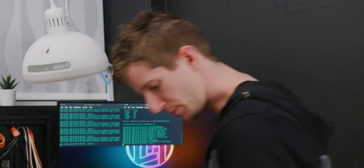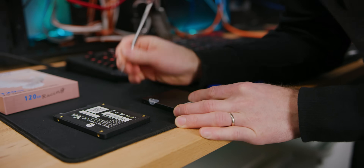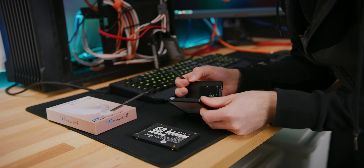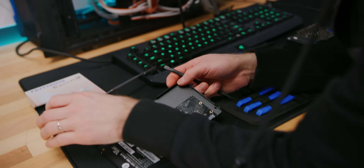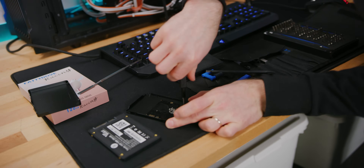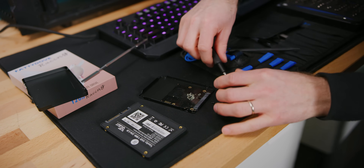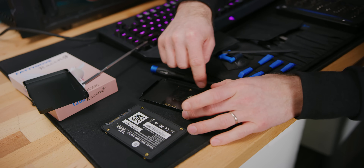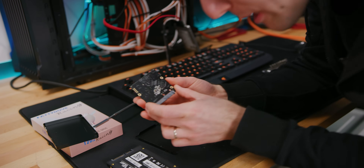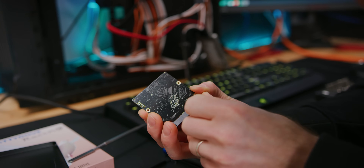Should I just start ripping this thing open? Do you want to void that warranty? Okay, open. Wow, that sticker — stop. Oh, and it's bent — you bent your Fatty Dove. That is not a lot of PCB. Based on looking at the back of the PCB, I'd say that's the controller right there. And I'm guessing... no DRAM cache, because it looks like there's just one chip right there.